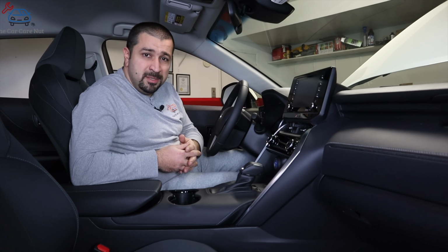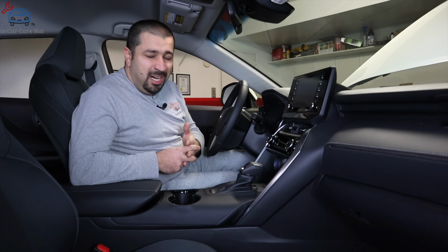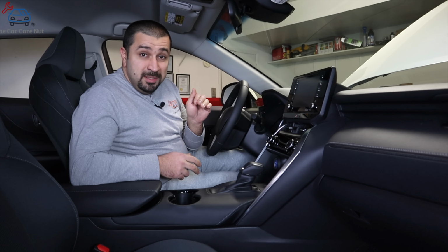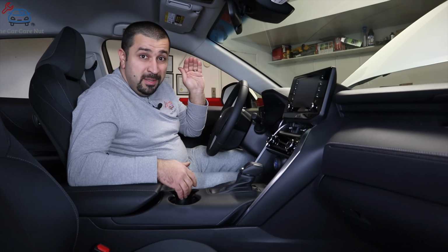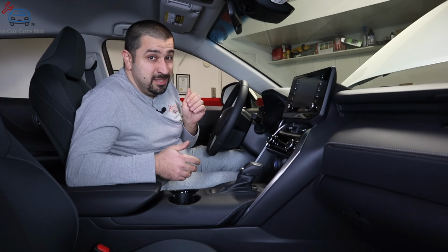That's its intended purpose. But I see people driving in B mode all day long. That is unnecessary stress on the hybrid system. All that's going on is there's no engine braking. There's no such thing. A hybrid system will utilize one of the motors to rev up the engine artificially. The engine is not running. It's just going to use it as dead weight.